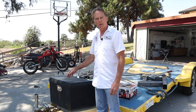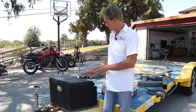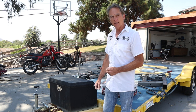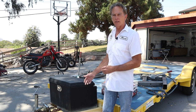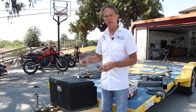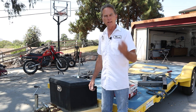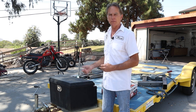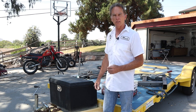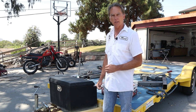I'm going to try to put a divider in here so he still has room to throw his chains and stuff on one side without worrying about breaking anything inside the toolbox as far as the winch controls. We're also going to remove the tongue jack — it's offsetting incorrectly so you have to put a floor jack underneath it every time to raise it up to pull it into position. We're just going to take that off, cut the welds, move it on the tube and re-weld it, then spray paint it. I can't fit the trailer in the shop so we'll be doing everything outside early morning before it gets too hot.